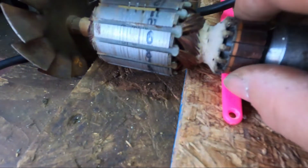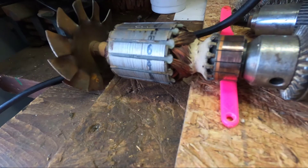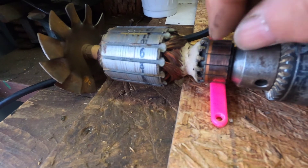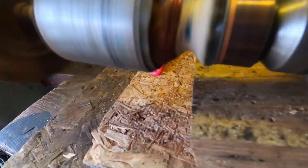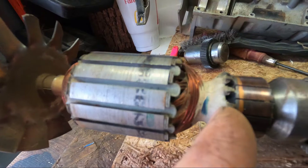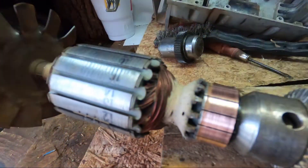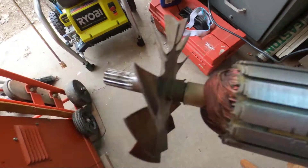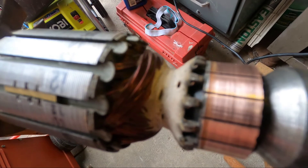Now I want to clean this up over here. Normally I would just rub some sandpaper around it — make sure you clean it off really well and blow it off; you don't want anything stuck back in there. Today I'm going to try something a little different: I cut a piece of sandpaper a little thinner than this width, got a block of wood so the fan doesn't hit the table, and while it's turning I hold the sandpaper over there at low speed. I have to be careful not to damage the shaft because that's the gear and bearing. Now that's some difference — you can see the difference on it now. Didn't take long, a couple of seconds. I found the best way was to hold the sandpaper with my thumb at low speed — didn't take any time or pressure at all. Cleaned it right up.